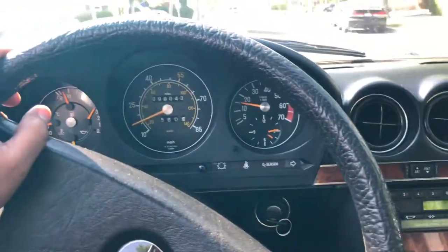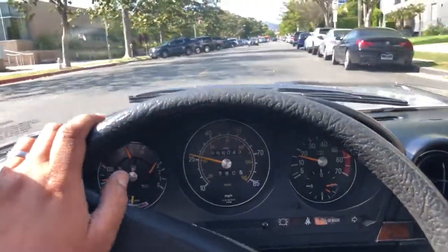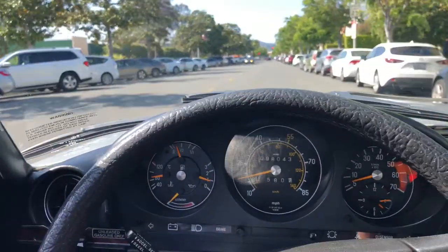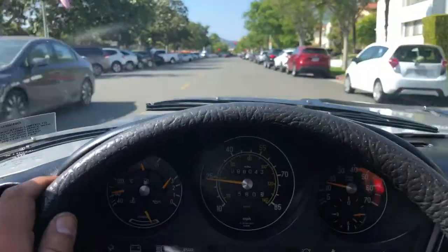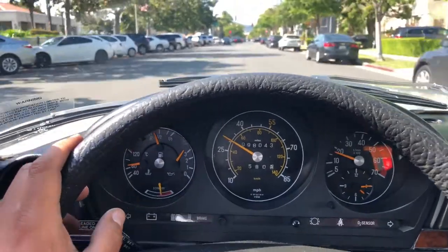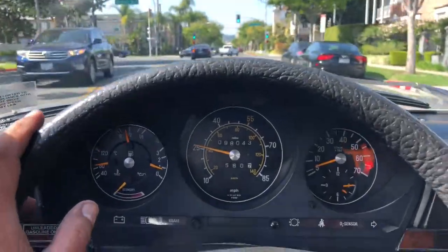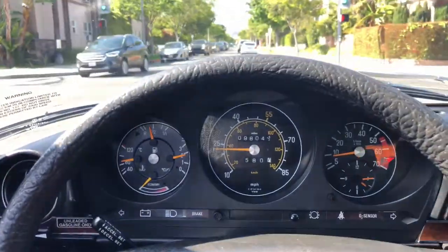Shifting seems to be seamless — goes through all the gears from low to high and finally into drive. When I apply the brakes with hands off, I just want to make sure it doesn't dart left or right. It veered a little bit, but there's some road crowning there. My top speed was about 55 miles an hour and I didn't hear any excessive tire noise. Engine is performing well, transmission was shifting nice, and I didn't hear any clunks from the transmission.